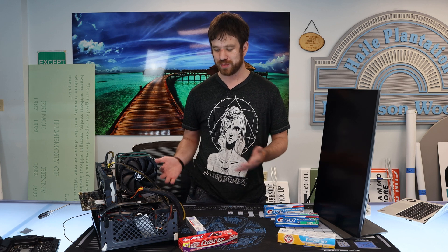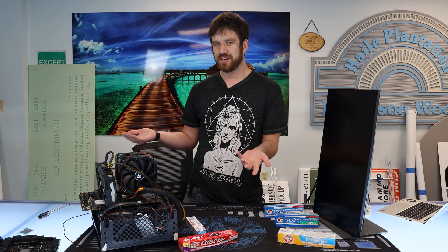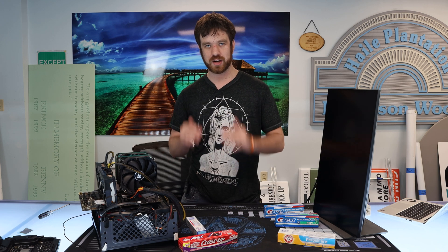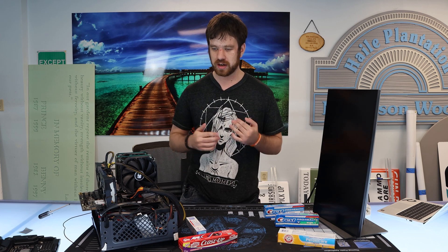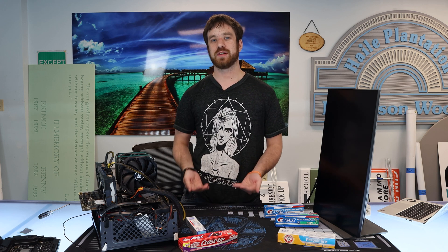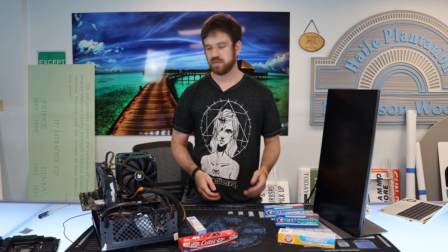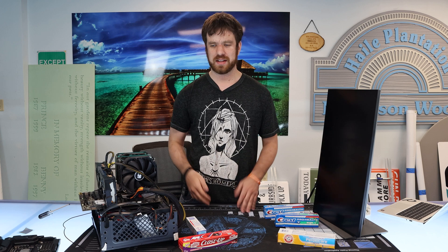Let's move on to our thermal battle royale. What we've got here is an old i7-6700K, Skylake - still good, still relevant. We've clocked this thing to four gigahertz. One point two five volts. We wanted to give it some headroom because that boy gets spicy. So yeah, four gigahertz, a little bit undervolted, and that way it's locked and there's no boost mechanic going on. The cooler is set to max speed, so it's going to be a straight temperature versus temperature comparison. For the actual test parameters, we're doing it simple - we're just going to run Prime 95 on small FFTs, which is the nuclear reactor test. We're doing an air cooler here, so I don't have to worry about thermal equilibrium or any of that. Five minutes, blast it and see what happens, then move on to the next.